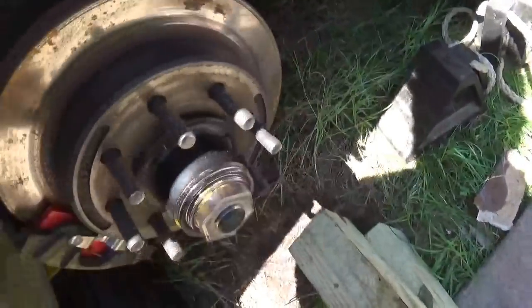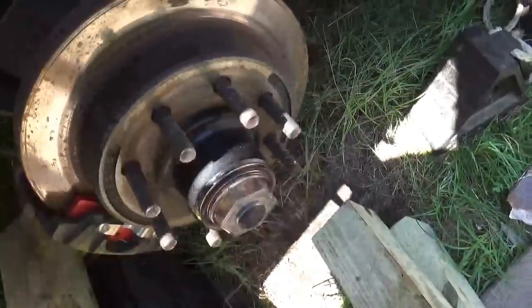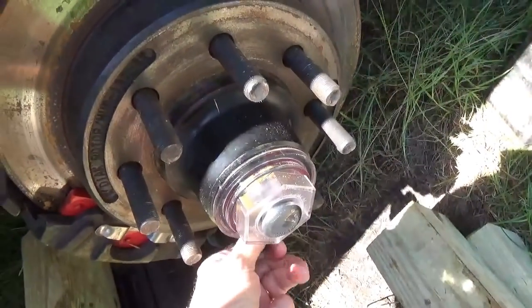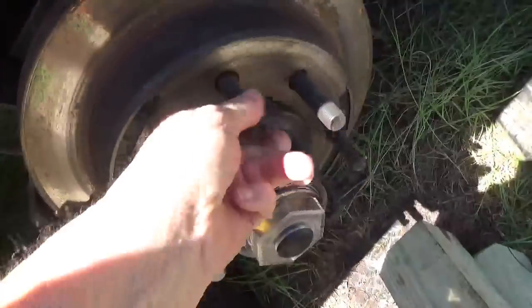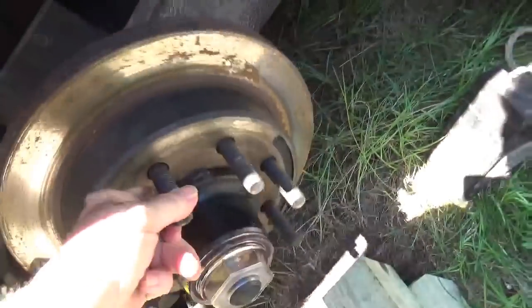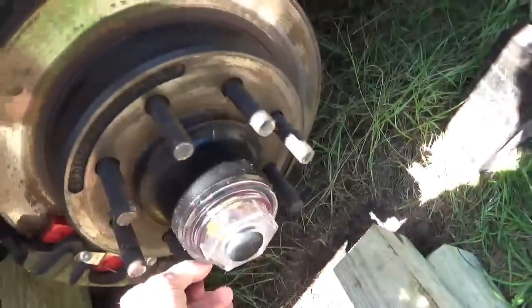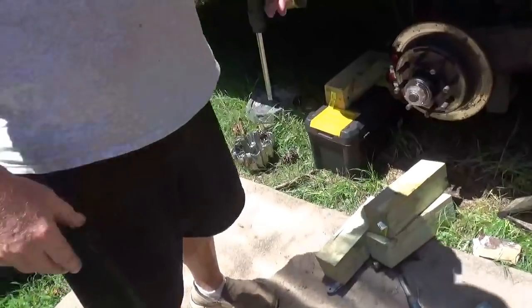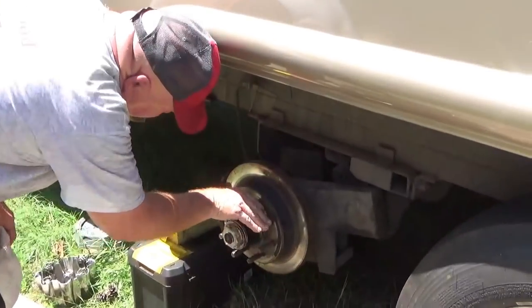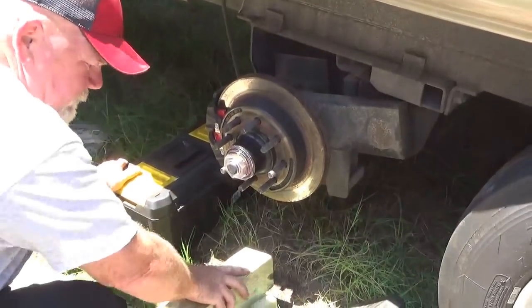When a piston comes out of the caliper, it presses on the inside shoe, which pulls the outside of the caliper inward, and it slides along those pins. If they jam when it goes to release, it just stays right there — it doesn't relax at all. Hopefully the extra grease makes it relax. Brakes are on — how does it spin now? It's rubbing, just a little bit harder. I think it's pretty good. It stopped though? Yeah, that's spinning good. It has a little drag — I've never seen one that doesn't. Let's put the wheel back on this side. Hopefully problem solved.